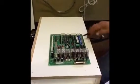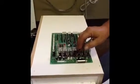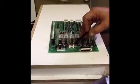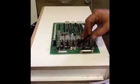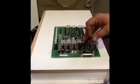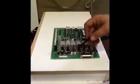The next thing to look at are your fuses. This is your F1 fuse. F1 is for your up-down motor — that's the only thing it controls. It doesn't control left and right or front and back. So if you have an up-down motor problem, the first thing you want to do is check your F1 fuse.